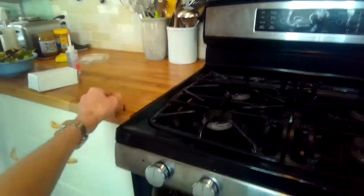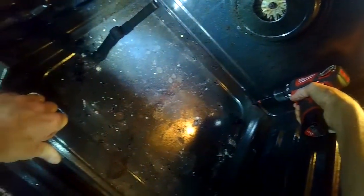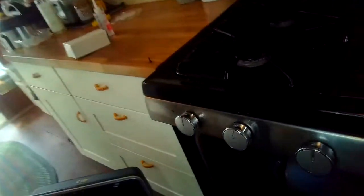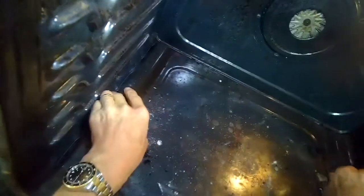I'm going to do it with the oven door in place. I got the racks removed. I'll take a quarter-inch driver and remove two quarter-inch screws that are in the back — sometimes these are held in by standard head screws, but these were just a hex quarter-inch. Then you pull up on the back of this bottom plate and lift it out at about 45 degrees, grabbing the vents and pulling up in the back, and the front lip will slide out of the frame.